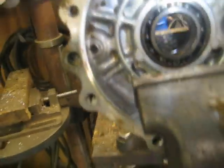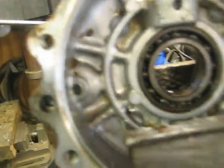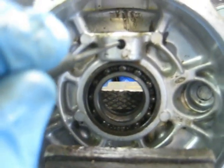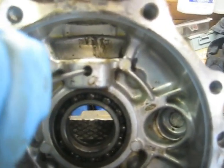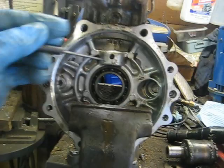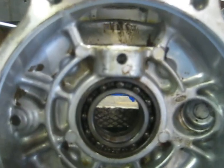There's actually a snap ring inside this hole - you can see it in the very center. What I do, and this is by far the hardest part of this whole process, is take a pick and try to catch the edge of that thing and slide it around. You're trying to get that snap ring until you can see the end of it. I usually get the pick in there, center it up on the ring, and tap it with a hammer until it slides over. Keep doing that until you see the end of the ring, then bend it out and pull it out with pliers.